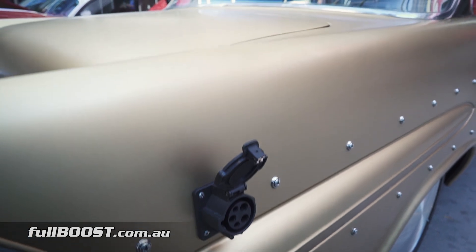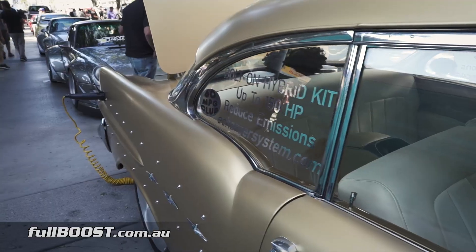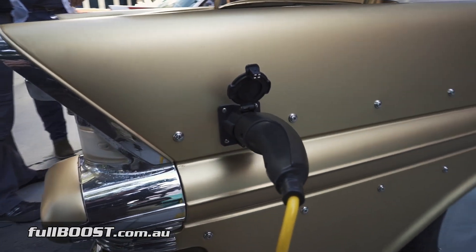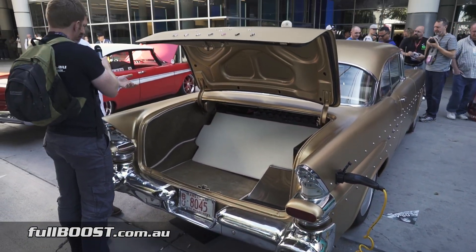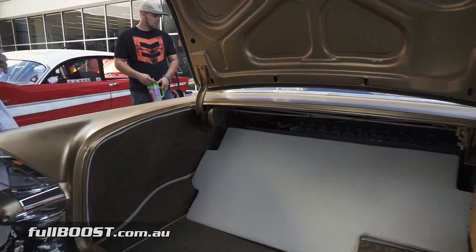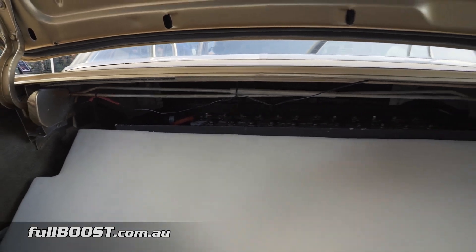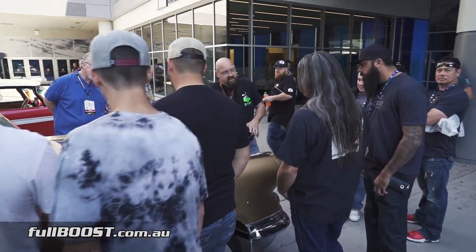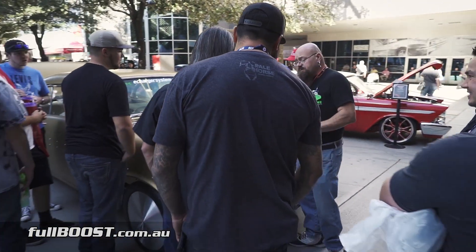In the back here we've got the batteries the system runs off. What you have here are lithium iron phosphate-style batteries — a 12 kilowatt battery pack. Each cell has a 100 amp-hour capability at only 3.32 volts, so 35 cells times 3.32 volts is somewhere around 115 nominal voltage. You could extend the range by simply adding more batteries. The hybrid kit itself only has a few parts: a battery pack, an electric motor, and a controller. Those 35 batteries add under 250 pounds to the vehicle.